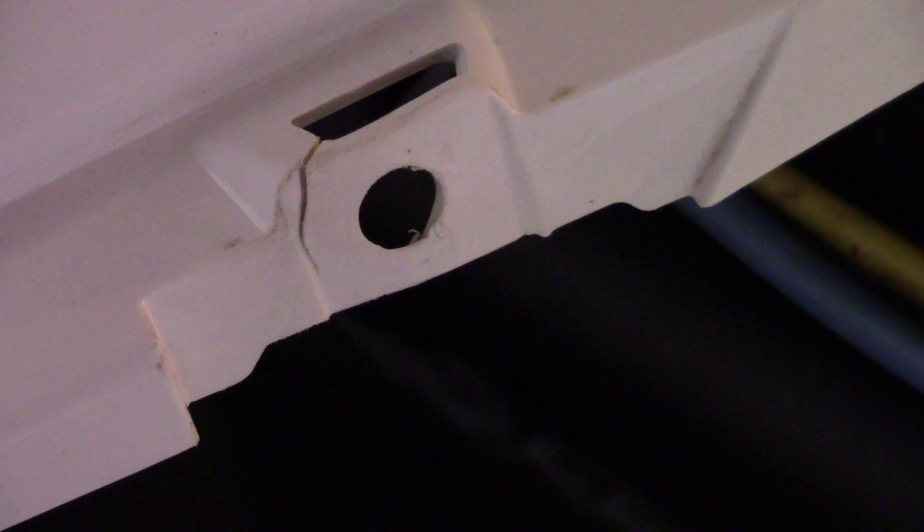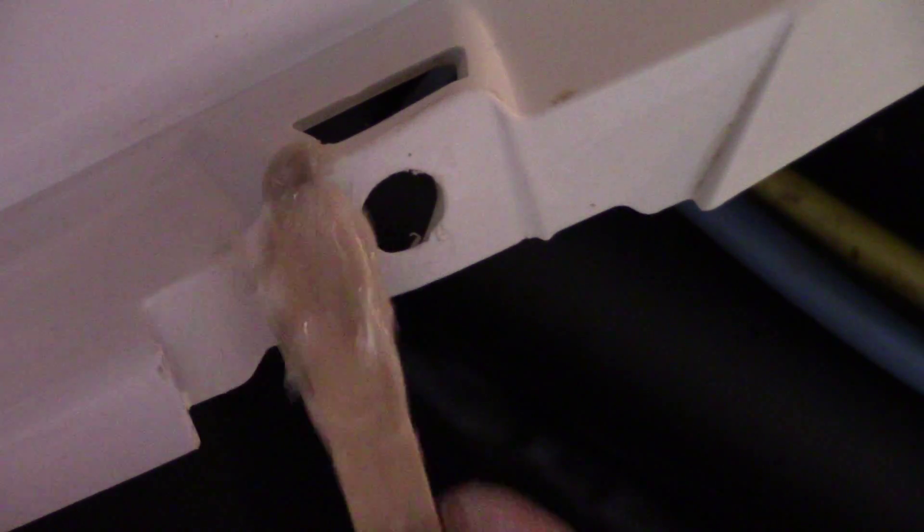For some reason, these Razors — I think if you were to pull your fender off, you would see the same crack on yours as mine has here. So let's go ahead and see if we can work on that. I've already mixed some up here in this little tray that it comes with. It's already starting to get kind of gooey. I'm going to use a razor blade to get inside that crack. Basically, all I really want to do is just fill it. It also fills up the crack — it doesn't just glue it together, but it can kind of fill it in as well if you've lost some plastic.